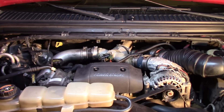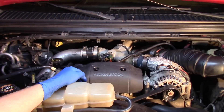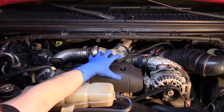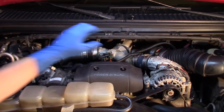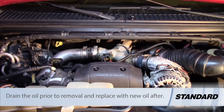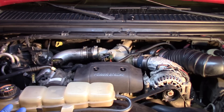The first steps in replacing the high-pressure oil pump, lines, and pressure sensor are going to be removing the cover as well as the back pressure sensor and the fuel filter housing assembly. You can see all of those steps in another video on our channel where we show how to replace the fuel filter housing assembly itself. Before we go through the steps we're going to drain the oil, because oftentimes when a high-pressure oil pump goes out it's due to debris or poor oil going through the pump. So we don't want to risk causing damage to the new pump by allowing that old oil to go through. We'll drain the oil before we get started and then do an oil change after we get the new high-pressure oil pump in, to make sure we have good clean fresh oil going through that new pump.